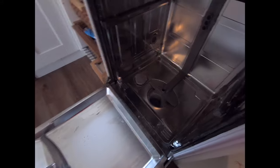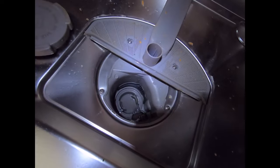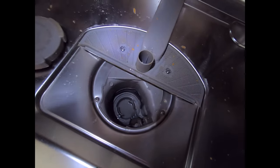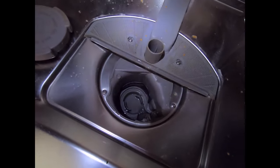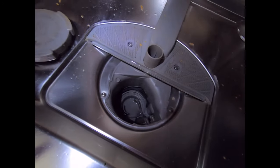So what I'm going to do now is reassemble the cover back over the impeller and then test the system by popping a program on it. The first thing it should do when you start a program is drain, and then hopefully if it does drain we're back in good order. Sorted — started the dishwasher, put another program on, and it's all working well. I hope that helped, and please like, comment, share and subscribe for more videos in the future. Thanks for watching.